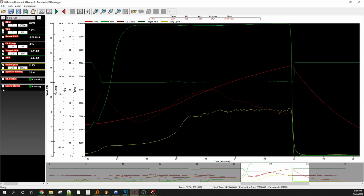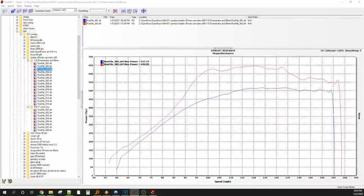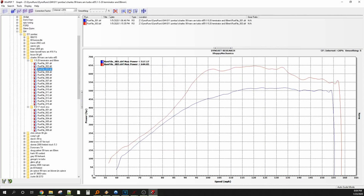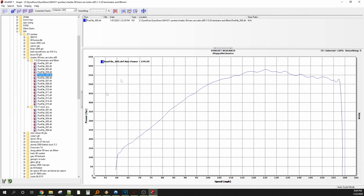Yeah, this 13 pounds. I believe we just were not getting the target we wanted. See, I threw a bunch of fuel in it up top, obviously, too, within 1%, 12 degrees, 12 and 12 nearly, and it still made 644. And then, let me look at the data logs to see. So here I started doing raw duty cycle because I couldn't get what I wanted down low. So here I entered 35% duty, and that was 10 pounds, and it made 580. So that was pull number five. So if we bring that up, yep, 580.